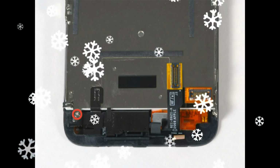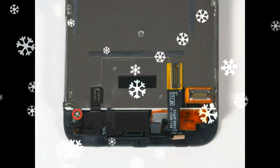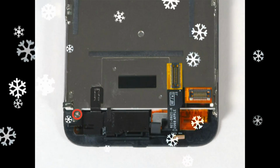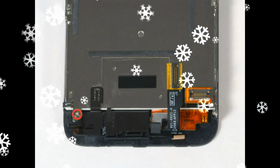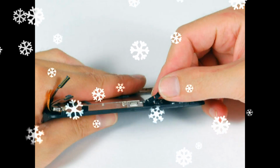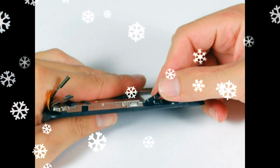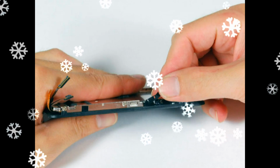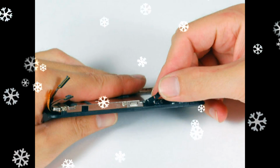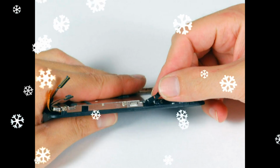In extreme cases you may have to pick off any glass shards that remain glued to the plastics, using a heat gun or hairdryer. Heat the top left area of the touch screen. Use your fingernails to slowly lift up the left corner. The touch screen plastics are held to the touch screen with adhesive. It may take some work to free the corners. Once the top is free, use the heat gun to heat the sides of the touch screen. Use a spudger to free the sides of the touch screen plastics.